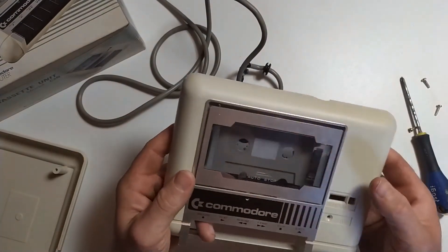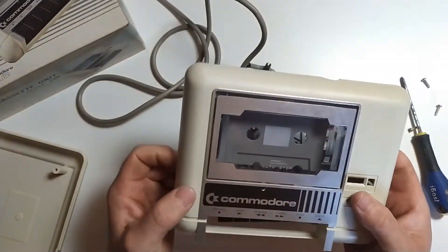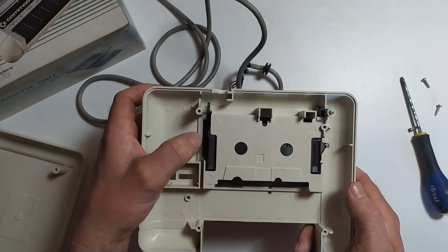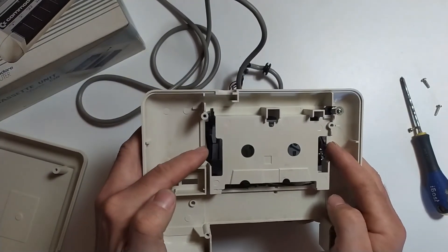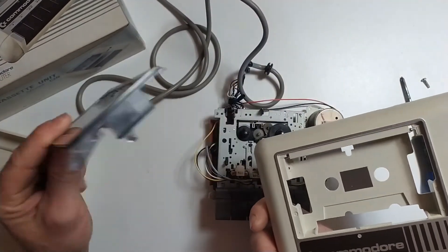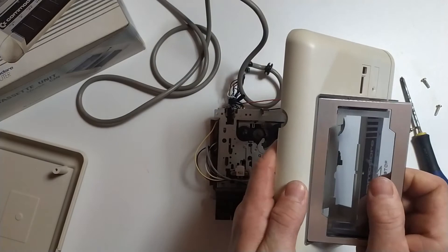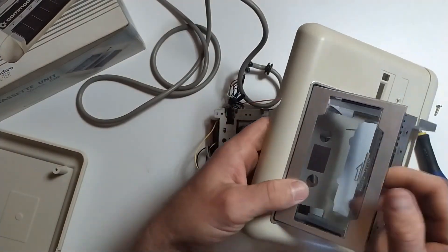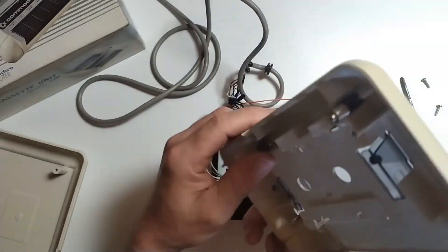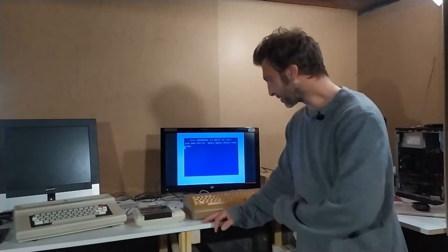One other thing: if you've taken your datasette apart and want to clean it thoroughly, this little cover here is not hard to remove at all. You just push in these two clips here and off it comes. To put it back, offer it up, make sure the gap across the top is closed, and with a little force reclose it. There we go, that's how that works.